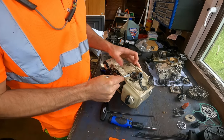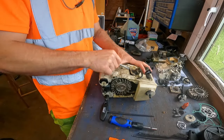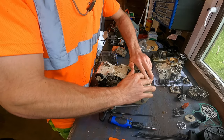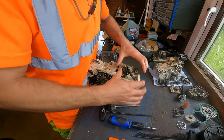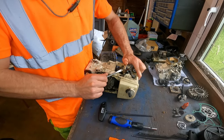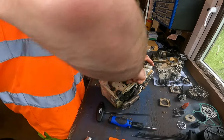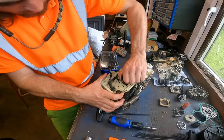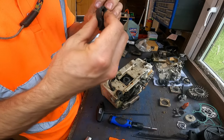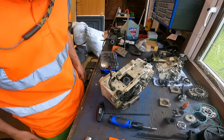Alright, getting into it now. Boot clamp - this will be getting a new one as they do wear - everything wears, it's rubber and plastic. It comes off there. Well rotted in there. The boot won't be surprised if this actually disintegrates in my hand - yeah, that's definitely past its best. Cylinder looks alright to be honest, a few bits blown in it but not bad.